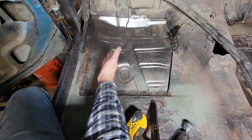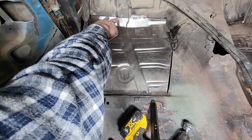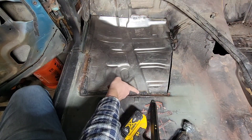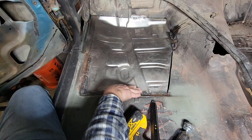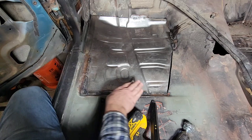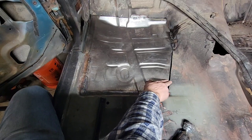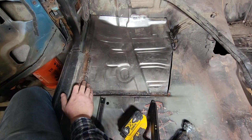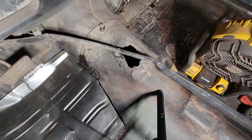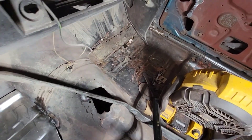There are stamps in there, so that's better than a sheet of regular flat stuff. They lined up a little bit up here in the top section — I tried to get those as close as I could. Down here in the bottom they're kind of lined up but it transitions, so it doesn't really matter. I'll grind that down and you'll never tell. I'll add a little filler piece in there and then move on to the other side, which is full of bondo — so that's gonna be a good one.